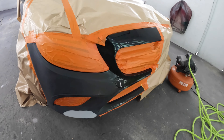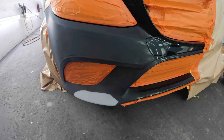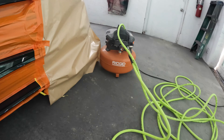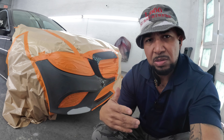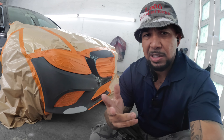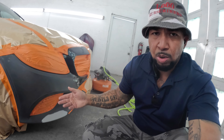With Trigger Man, back in the lab. Today we're going to be doing a small little spotting job — show you guys how to do a spot repair for clear coat base. You're going to do your normal fade, but then spotting into shiny clear. We're going to do it with a little mini setup — basically for somebody wanting to do mobile work, touch-up bumpers at a car lot or something like that. Mercedes paint code 979. We're going to do it with a little mini spotting gun and mini compressor — small stuff you can take to car lots, do touch-up work, make you $200, $300 per little job.